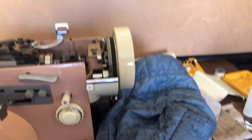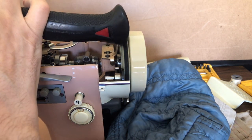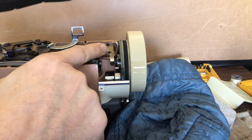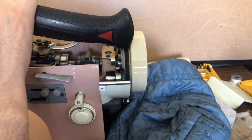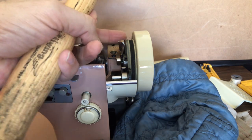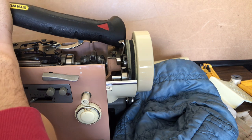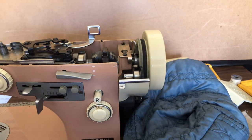The last thing you want to do is make your machine look older because you were trying to make it better. So I'm going to take the rubber end of the hammer again, come down on either side of this piece — do not hit this bracket, that's not going to help you with the hand wheel and you don't want to damage it. I'll just tap it, and I'm over here with the mallet — just tapping gently on either side of the metal bracket. The gap is getting a little wider.